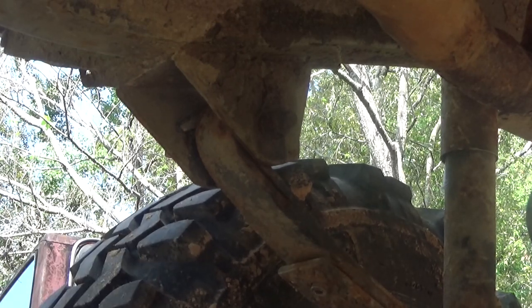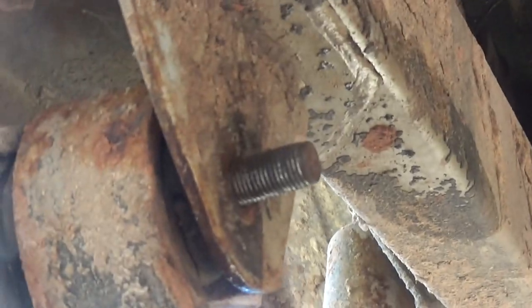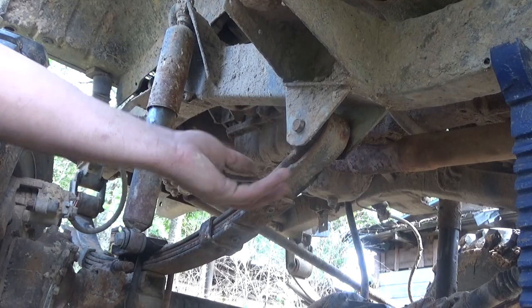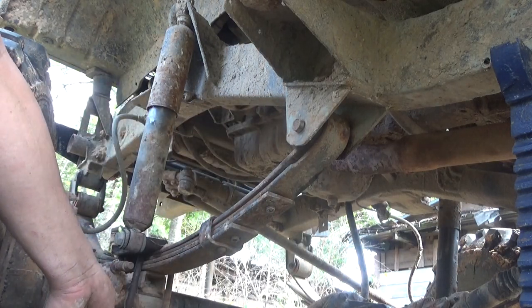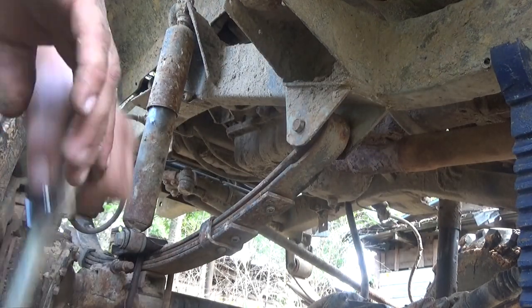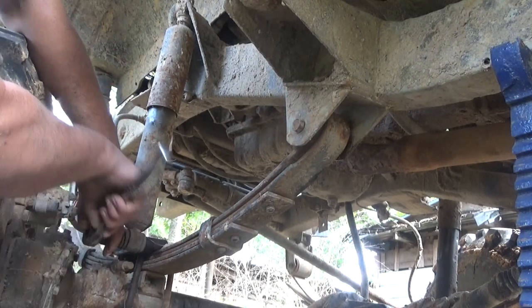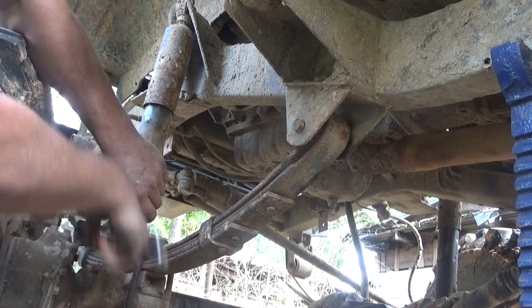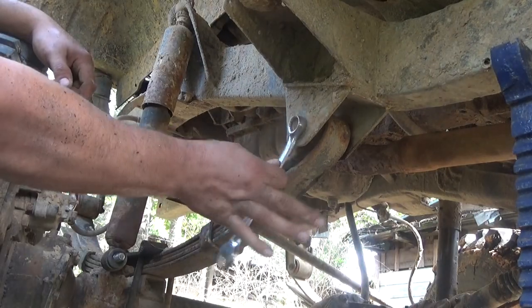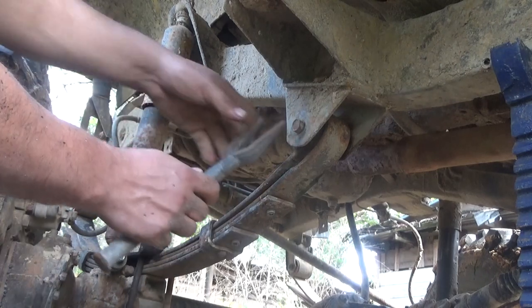These should be 17 millimeter. Now that the nut is off, the trick is to get the weight off the spring — off this bolt. You can do that by raising and lowering the axle now that the frame is stationary. I'm going to go ahead and take my shock loose in case that's causing any issues. It's loose. It doesn't have that much pressure on it, but you still got to be careful not to mess up the threads — they can take a little abuse but you can't be beating on them too hard.